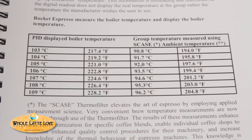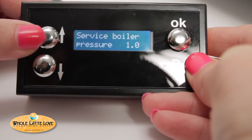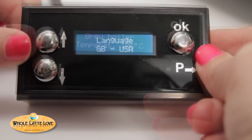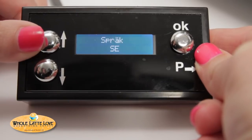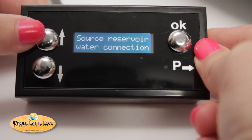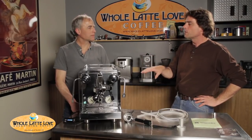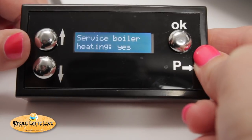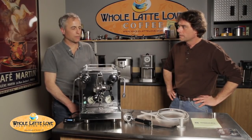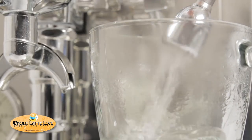You use a chart to calculate what your actual temperature is at the brew group. On the remote you can set the pressure for the service boiler — that's your steam and hot water — and set the temperature of the brew boiler. The control panel supports four languages, and you can program it for plumbed or reservoir operation. You can also shut the service boiler completely off if you're not going to be using any steam or hot water. The brew boiler is independent of the steam boiler, so it doesn't need hot water from the steam boiler to pre-heat the brew boiler water, like with other machines.